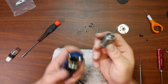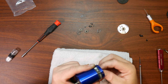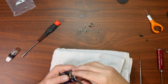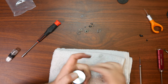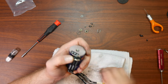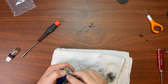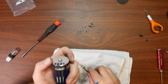Now what we're going to do is take our comm and insert it. Don't forget to put your brass bushing, and we're going to put the back plate back on. Now the other thing too — there is a rubber seal on the back here, you want it at the correct place when you're inserting your back plate. It goes behind the aluminum casing at the same time as you want it flat.